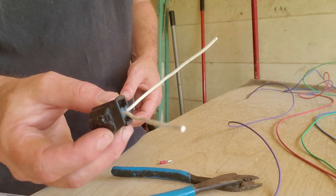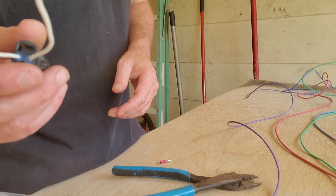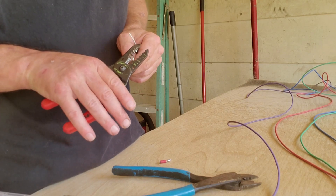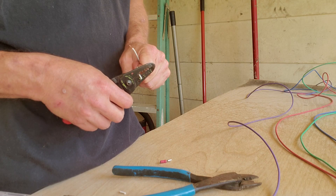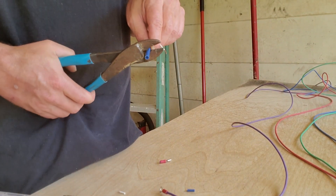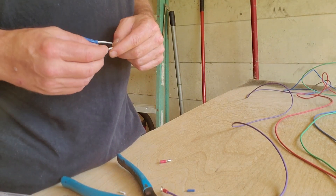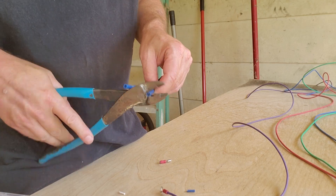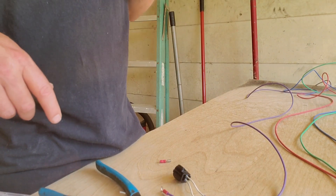These two wires here — cut them so they're even so it makes it nice and easy and looks better. But these two don't matter; these are just field wires, they don't matter which ones they go to. So I'm going to get out to the truck to get the right length on this stuff. I'll strip these and crimp the ends on, then cut those other ones to length. Hopefully the voltage regulator will regulate like it should, and then I'm one step closer to driving Beddy.